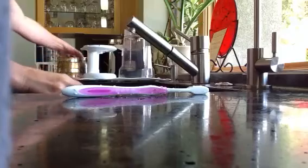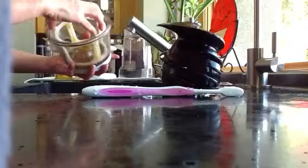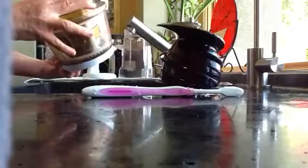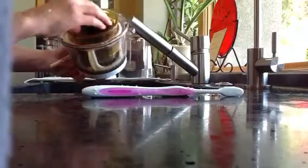To put it back together, take the blades and put them in until they seat — they sit down in there tight but still turn. Then you put in the basket. You turn that until it clicks and it locks. There's a little hole in the basket that lines up with the feeder tube for the pulp, so when that's locked in, you know it's in there tight. And you put the screw in, and when you turn it, the blades turn.